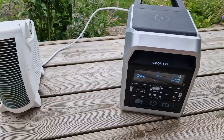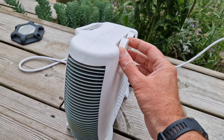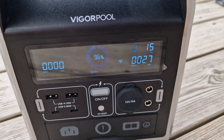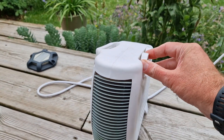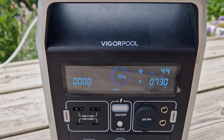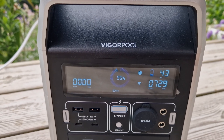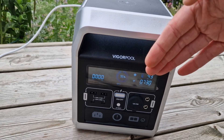This does have an app and Wi-Fi connectivity, which is pretty cool. So we've got the fan heater — on its first setting that's just the fan, about 30 watts for the cold air blowing. Now let's give it the beans — put it on the 1000 watt setting. You can see it's gone up to 955 watts. What's interesting is that even though it hasn't really got enough continuous power to run this fan heater, it's still doing it because it's a resistive load.